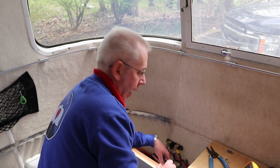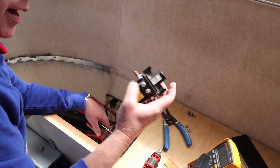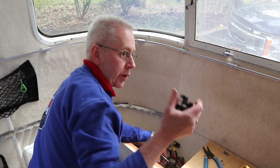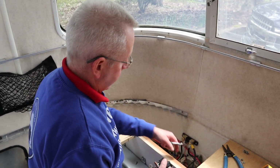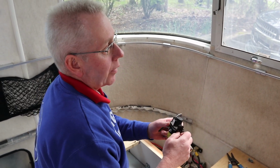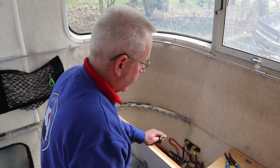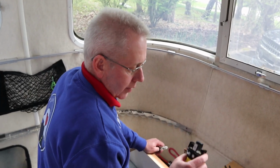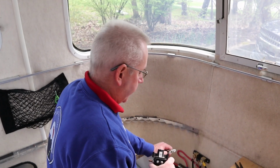So as part of getting ready, I am replacing the battery disconnect switch. What happened was when we went to install the battery and go from store mode to run mode, we could hear clicking at the switch, which told me the switch was still working. But nothing was happening here. Only about 2 volts was coming out this side. I checked the volts, everything going in was good, until it hit the disconnect switch. So my theory is that this switch is faulty. So we're putting in a new switch, get the battery hooked up, go from there.